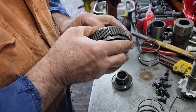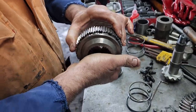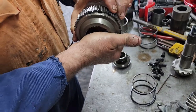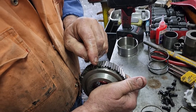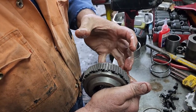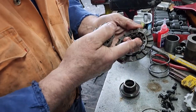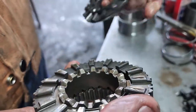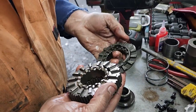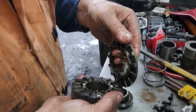That one and that one go together. So when this is being driven and one wants to go faster, they've got excessive clearance in these dogs so that when it moves forward it's got time to disengage. How that happens is those teeth right up on these cam faces — see that? Watch, I'll put it together again and you'll see this is the main function of the Detroit Locker.